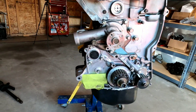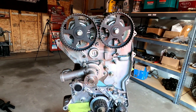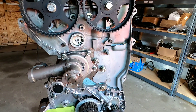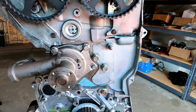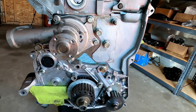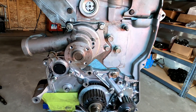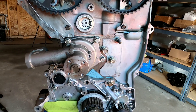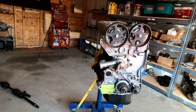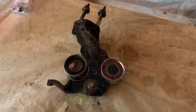The water pump stays as a six bolt, all the components — even your oil pump — all that stuff stays the same. The only thing we are going to modify as far as getting the engine mounted into the engine bay is we're actually going to be cutting the 2G motor mount. The reason being is it actually has an extra ear around this general area that needs to be sliced off — trimmed — in order for it to work and fit onto the 2G engine bay. All your transmission mounts stay the same, no change there.